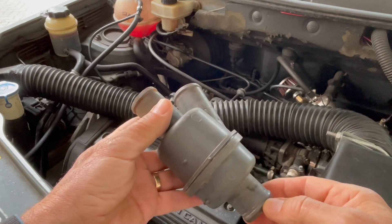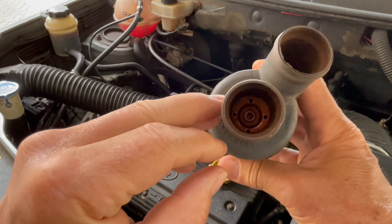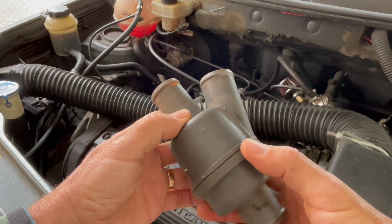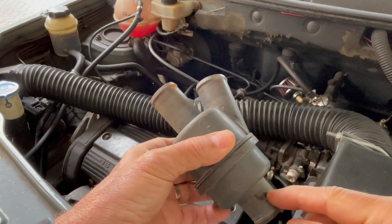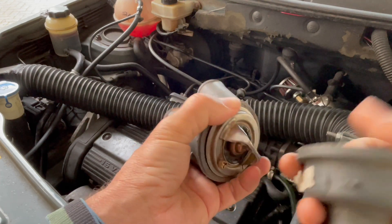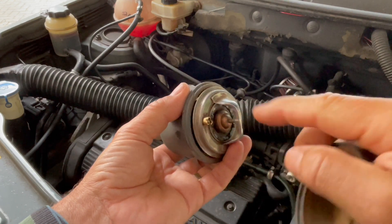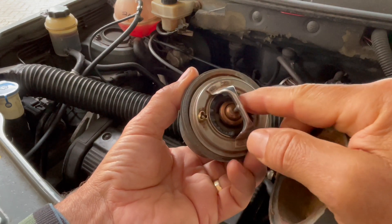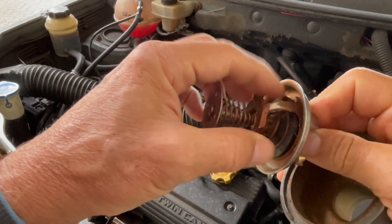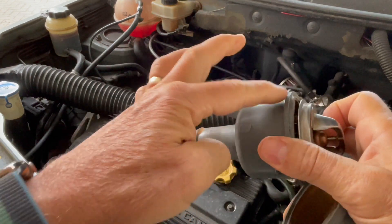Let me describe the failure mechanism. The car starts off cold, the radiator is cold — this problem is worse in cold weather. You've got a small amount of flow from the engine; the hole is pretty much blocked by the face plate. As the engine warms up, nothing is flowing through the radiator side of the thermostat — the thermostat is sitting stone cold right on the sensor. If the cold water is particularly cold and there's a tiny bit of leakage through the seal where the thermostat closes, the cold water from the radiator will keep the thermostat closed even though there's a small amount of hot water from the engine flowing back to the bypass.